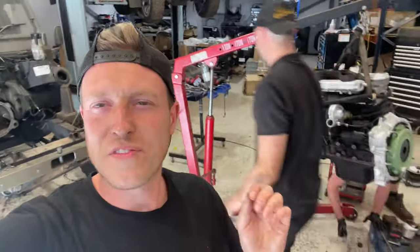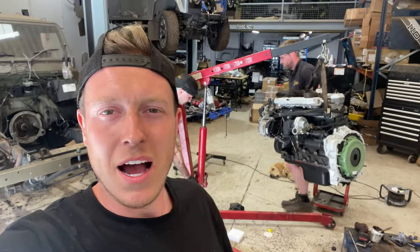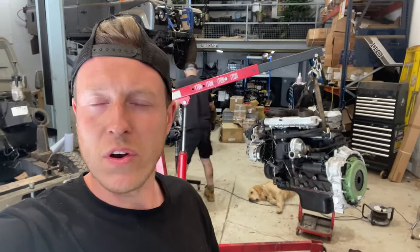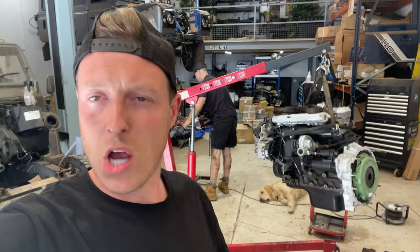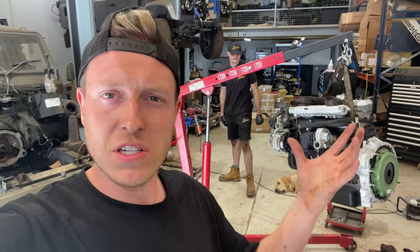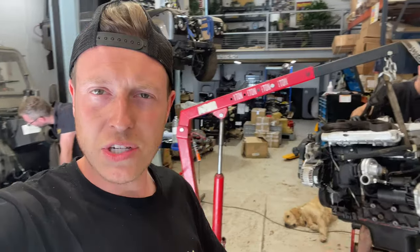The time is finally here. We've got everything prepared. The engine is fully built up. As I said, we've changed the clutch, the rear main oil seal, rear main oil seal to block gasket. We've got a new spigot. We've got a whole new cam belt kit, water pump, turbo cartridge has been replaced, all new gaskets throughout. Rocker cover seal, brake vacuum pump, new sump itself, new alternator, all new tensioners, idlers, aux belt.